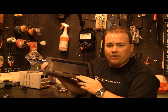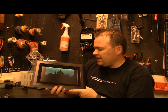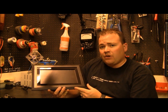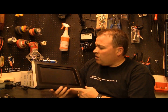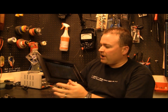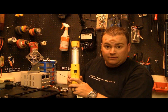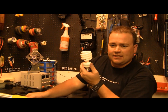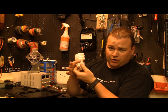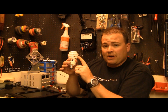The inverter for the backlight went out. On any kind of LCD screen — be it a laptop screen, a computer screen, or these little picture frames — the backlight is powered by a fluorescent lamp. This is a compact fluorescent lamp, and they have a high-voltage inverter that powers them. So either the inverter can go bad or the lamp can go bad.